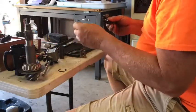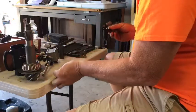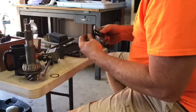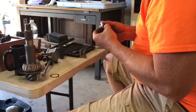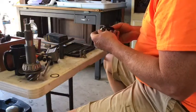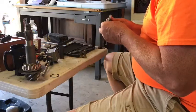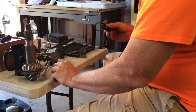This shim was actually 22 thousandths thick — I measured it in a couple of spots. So this was my thicker one, and I said I need one that's just a few thousandths less. As I'm going through this, I found one that is 18 thousandths, so that's a difference of about 4 thousandths, which is pretty small. But I'm hoping that will get me in the ballpark because I was over my preload.